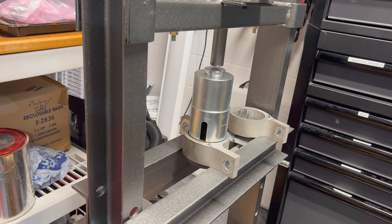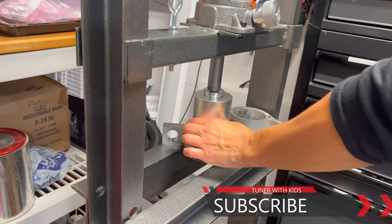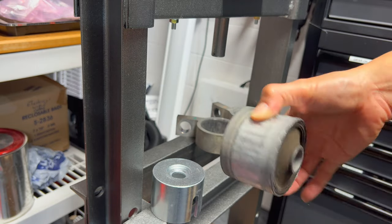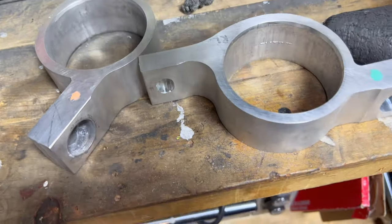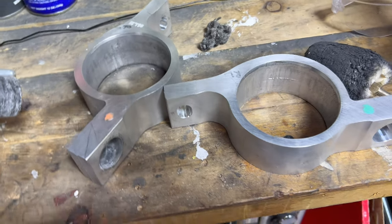The other side is not pressing out as straight and easy as the first one, so I'm having a little bit of trouble getting the pressure on it. This side finally came out. I did puncture it a little bit with the press and it started leaking a little bit of oil out because this thing is fluid filled. I used a little bit of steel wool to clean up the burrs inside and also cleaned up the rest of the mount to get rid of all the old tarnish and oxidation. I'm going to polish it up with a drill attachment and then go press it back together.